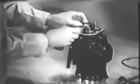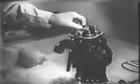This rocker arm shaft comes out easily. Sometimes you'll have to tap them out with a soft drift. Be sure to tag the rocker arms so you'll know which is exhaust and which is intake.